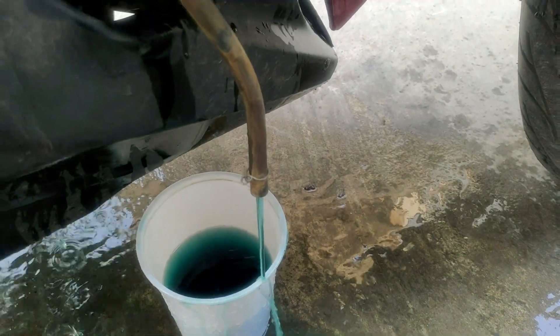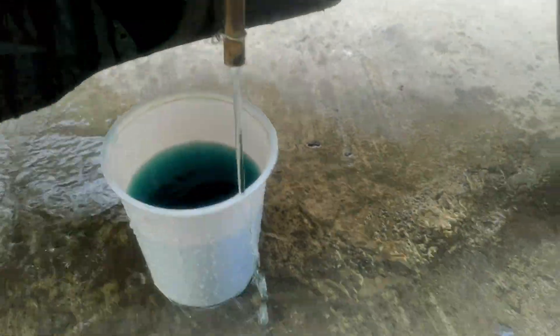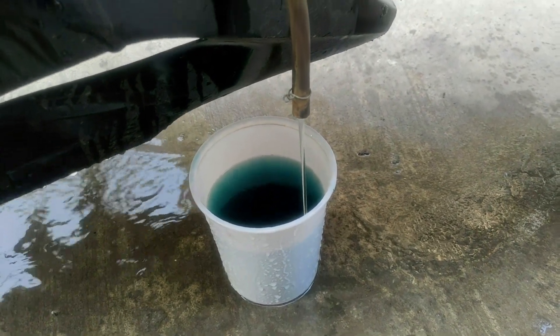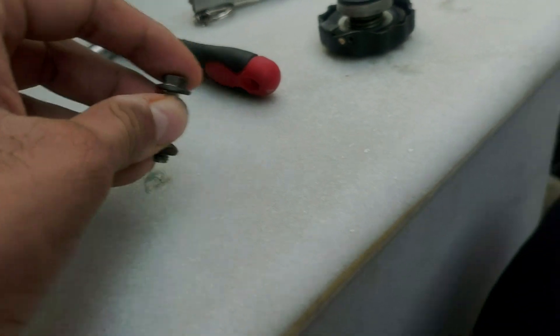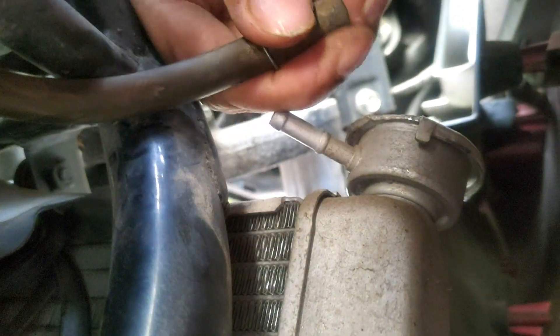It is time for the reservoir, and as you can see the reservoir is releasing everything. There's a lot of coolant coming from the reservoir — keep doing that. As soon as you see white or transparent water, stop the hose and let all the water drain out so that it is clean. Now it's time to close everything we opened up, and before that let's clean the bolt so it doesn't have any dust on it, as well as the pipe to the reservoir. This is actually very important — lock it up too.